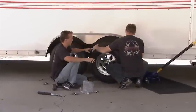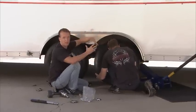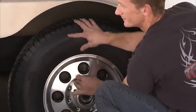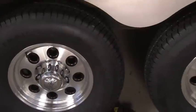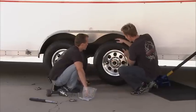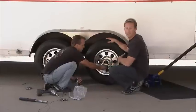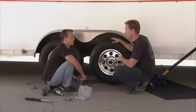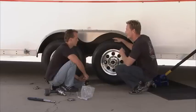When changing out all the trailer tires, make sure you use the right size and use all the same size tires. The trailer manufacturer will tell you what size tire to use. Change all of them at the same time — even if one isn't blown, if you don't replace it now you're likely to have it blow a couple weeks down the road and destroy the side of the trailer. Also check the tire pressure: look on the side of the tire for the max pressure, and check it when the tire is cold. Under-inflated tires create excess drag, which causes excess heat, which causes them to fail. Spend a few minutes, change out all the tires, make sure you have the correct tire pressure, and use the right trailer tire — and you should be good to go.